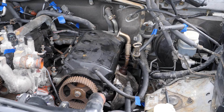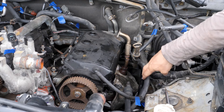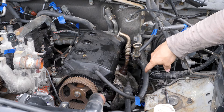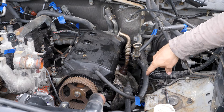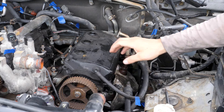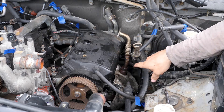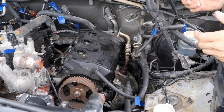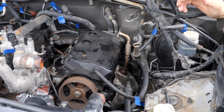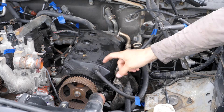I've run into a potential roadblock — I can't get the bolts that secure the exhaust manifold to the exhaust piping off. So I'm going to see if I can get the head off by just unbolting the exhaust manifold and lifting the head off, then taking it off the exhaust manifold. But to do that I have to take off the valve cover first.